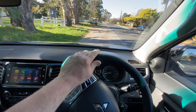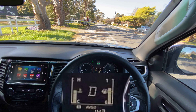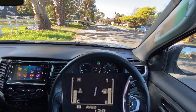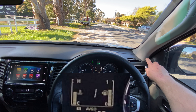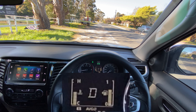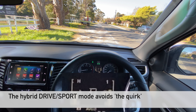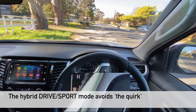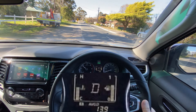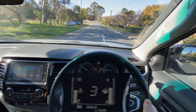I'll pull over and show that now. You can see it says D — we're actually in sport mode at the moment. If I turn Lock-Up Mate off you'll see it's gone back to one, back to normal sport mode. If I turn Lock-Up Mate on it's gone to drive, so it'll actually stay in drive until you go above 30 kilometres an hour — it's kind of a hybrid drive. Below 30 it's drive, and above 30 the driver is back in control of the gear shifts. Taking off now — we're still in drive, hit 30 kilometres an hour and now it's in third gear, so it's locked up.